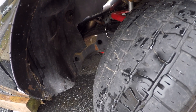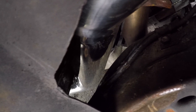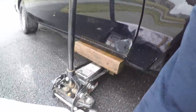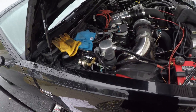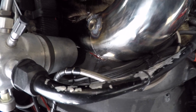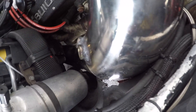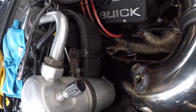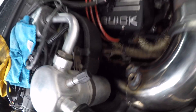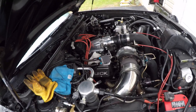I'm just gonna mark it and put a cautionary dent on it just to clear the arm at full travel. Other than that I don't think I'm gonna need to do anything on that side - as you can see you can even see the ground there. In the bottom you can also see it's a lot better. The one thing that is different with this pipe is that I did have to trim it to clear the heater box - what this pipe is doing is coming out further and then kicking down, over, and back in, which is what the other pipe was missing. Once I get the clamp on there it should move it over a little bit but should still be perfect.